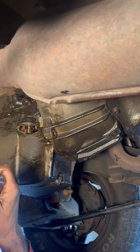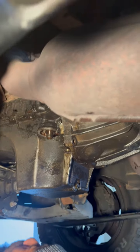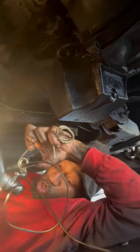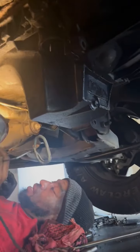The way it's moving, it looks like we are missing maybe one or two bolts. It looks like it's still being held up a little bit because she is moving. Let me spin around and check. We'll be right back. We took a quick break to do some double-checking to make sure we didn't leave any bolts in — we did find one or two that Keys is going to remove. Pro tip: if you start wedging something in there and it's moving from the flywheel but not coming down, that tells you that you did not get all your bolts out. Stop prying, grab your light, and look real clear to see if you missed anything.